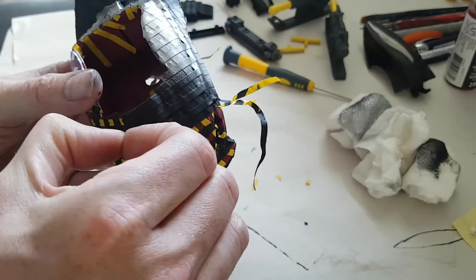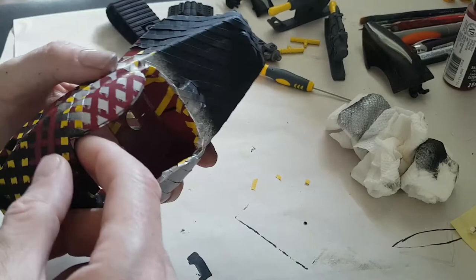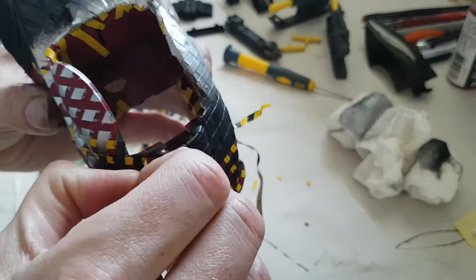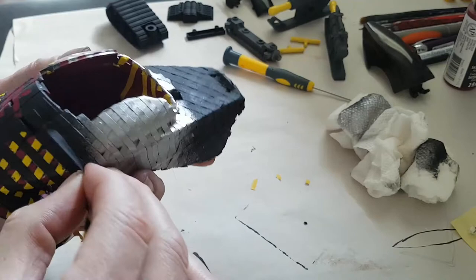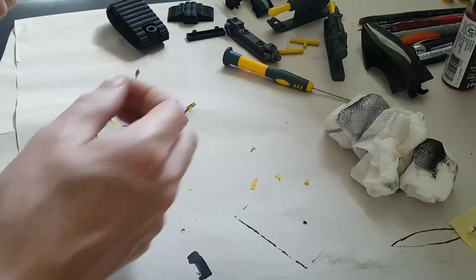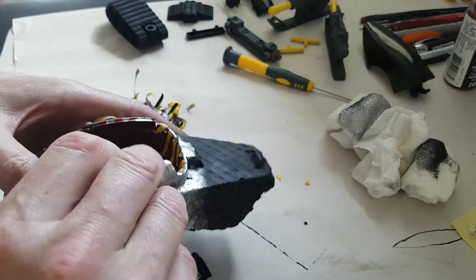This is the part that's kind of weird because you're revealing parts of the pattern. You pull off one strip and all you see is a straight line of burgundy, for example. But then when you get the other tape off, there's the pattern. If you're doing fine lines with hard masks, it's technically best practice to pull towards the color you're masking off. But good luck doing that with this many little squares and diamonds all over it. Don't feel you have to stay in one spot removing your tape — start one place, get as far as you can go, then switch somewhere else.